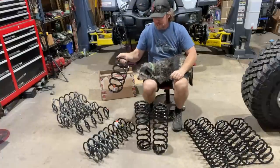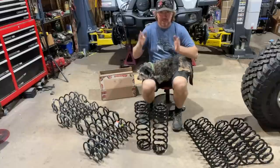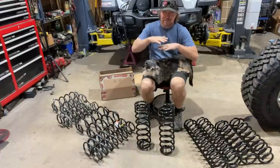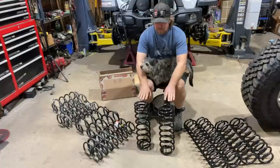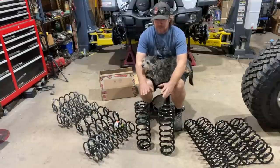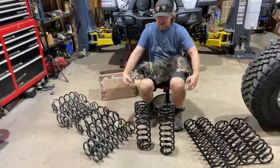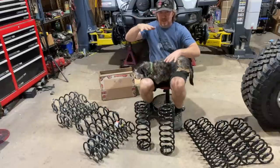That's because the Mopar coils are linear, meaning the spring rate stays the same — if it takes a certain amount to compress the first inch, it takes the same amount to keep compressing each additional inch. The Synergy coils are progressive rate, so they're lighter when they first start compressing and then get stiffer as compression increases. What this tells me is that when I put these coils in the back of the Jeep, they'll lift it two inches, but also at full droop there will still be tension between the axle and the coil bucket so the coil stays in place. The shocks act as limiting straps, and that slight compression tension keeps the coils from wanting to pop out.